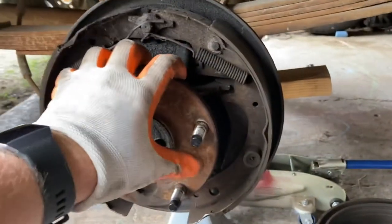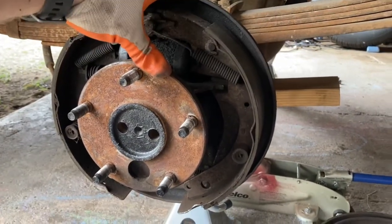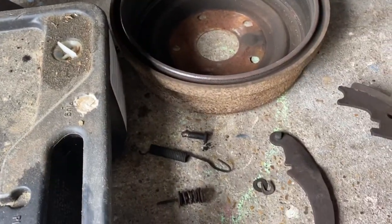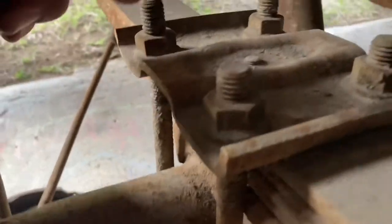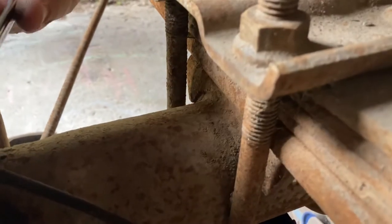I don't have a camera stand currently, which I'll try to get in the future for a time lapse. One of the first things I do when I take the brakes apart is lay them on their side accordingly as I pull everything off. Here's the wheel cylinder on the left. I don't have a crow's foot wrench, so I'm old school with a regular wrench. I went ahead and cracked the line — you're going to be using a 7/16ths.